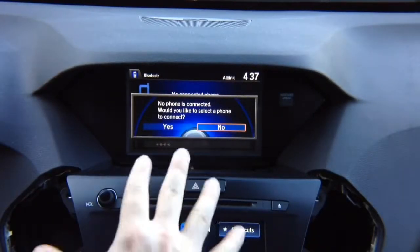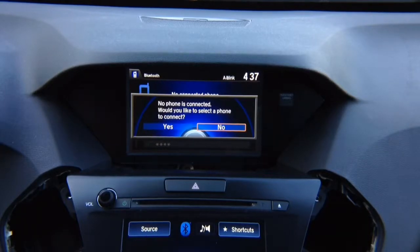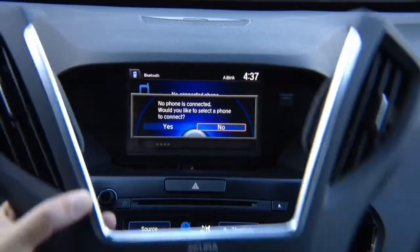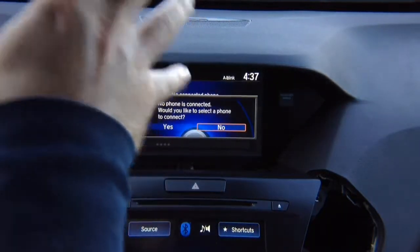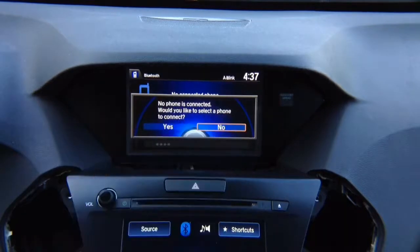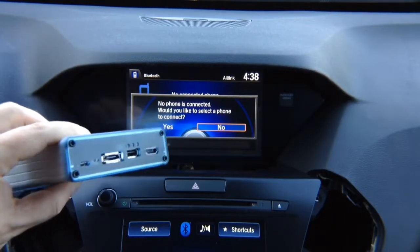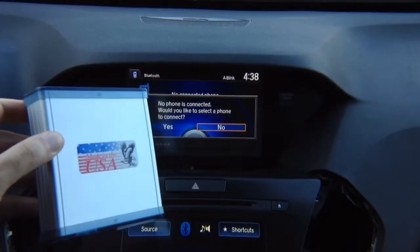This radio — we don't care about rerouting it. Everything will work as before; you're not going to lose any features. When you install this interface, all factory features — steering wheel controls, all cameras, everything — work as before. The screen is only used to display HDMI, cameras, or Apple CarPlay and Android Auto. The joystick controls CarPlay, Android Auto, or cameras when the interface is activated. Once deactivated, it's like factory — the interface is see-through, as if nothing is installed. To operate, connect the interface to a Windows or Mac computer and program the software through micro USB using a standard USB data cable — make sure it's a data cable, not just a charge cable.